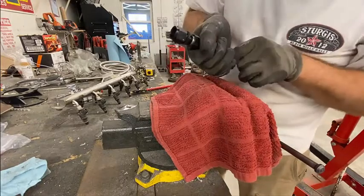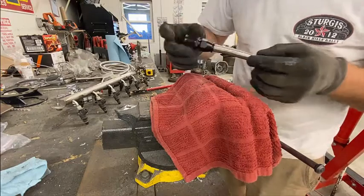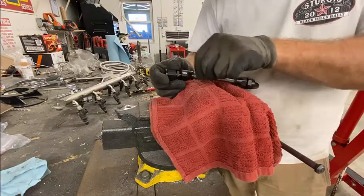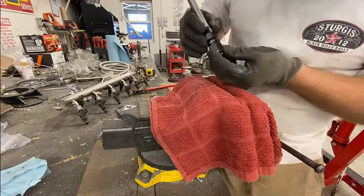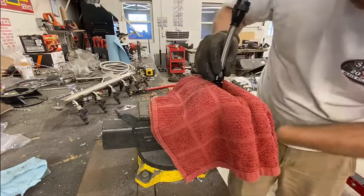And then bring that collar up, start to turn it. You can see that it's gonna start fitting, all right? Now here's the thing. You have to put pressure this way to keep it seated in that aluminum bung or it will pull this back out. So that's why I got this cloth here. You tighten off of the second piece. This is gonna rotate, so you wanna get that second piece because it's the stagnant part. All right, so put that in your vise.